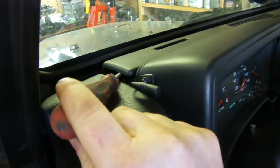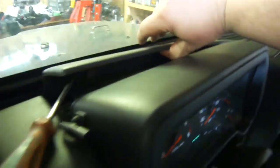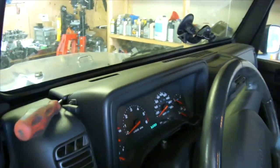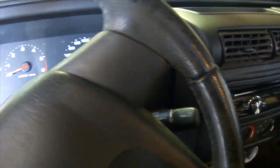One of the first things you want to do is remove your little top cluster trim. Get a flat blade screwdriver, jam it in there, and then physically pull it out — otherwise you'll snap it off. Pull that out of the way, and then the next thing is remove two Phillips screws, one right there and one right there, and pull this bottom section out.